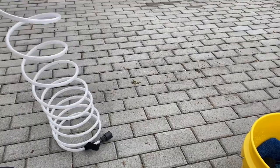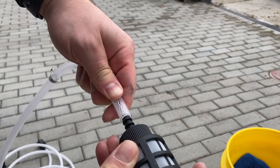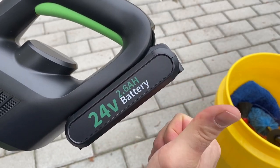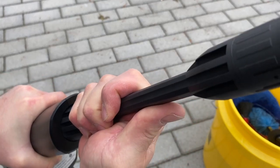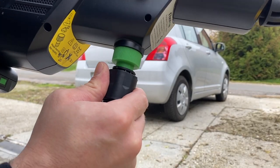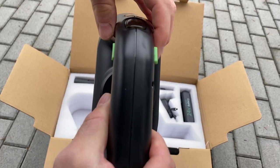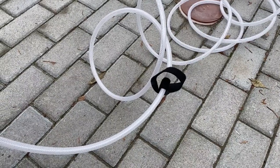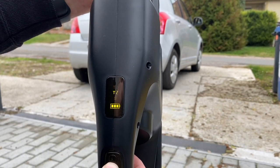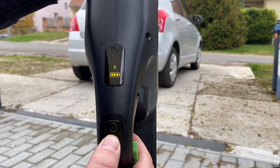This 6 meters long suction hose is fairly kinky out of the box, so straightening it by hand is ideal before you attach the filter to the end. Once that's done, pair up the pressure washer unit with its battery pack, which clicks into place very easily. Push in and twist the spray lens, then connect the suction hose with the quick release fitting. Now you are ready to unlock the two-way security button by pushing it out to either side, then pull the trigger and fire up the system. My favorite feature is the digital display, which gives you continuous visible feedback about the pressure settings and remaining battery life.